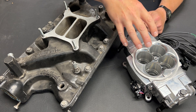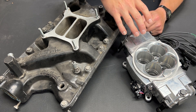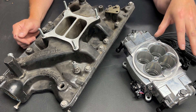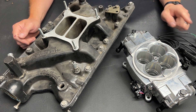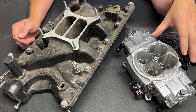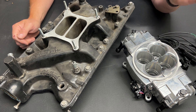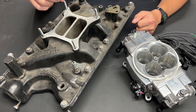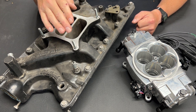The first concern is that heat is hard on the electronic components in this — not specifically the injectors but the computer components that live in either end of it. For best results and long life, you want to put an insulative spacer between this and your intake manifold. The other important thing is that this type of throttle body EFI, because of sensors mounted to the underside that help control flow, really needs an open plenum situation. That's a problem for me because open plenum intakes are a lot taller and height is a major concern of mine.